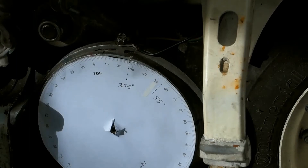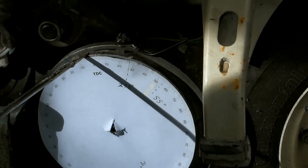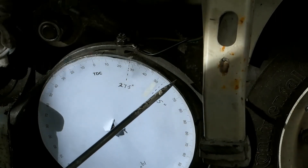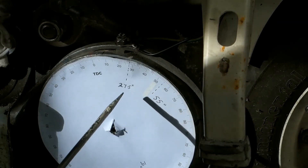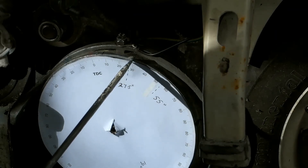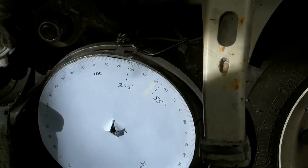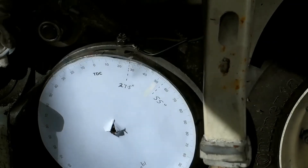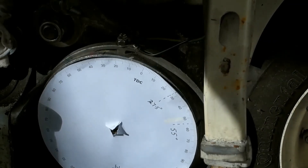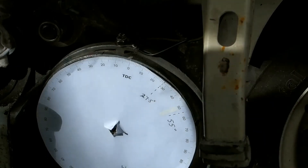It's a new day, sky's blue, sun's out — time to find top dead centre, which I've already done. Zero's on. I rotated to piston stop mark 1, then piston stop mark 2: 55 degrees. Half of that is 27.5 degrees — top dead centre. There's a groove in the casing right where that paint mark is, probably the factory setting — bang on. 27.5 on the setting piston stop mark.